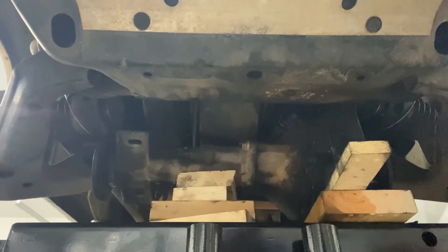The front differential is out — I'll spare you the 15 minutes of wiggling it back and forth. The key tip: as you lower the front differential, tip it forward to clear the rear mounting bracket, which is welded to the frame. Now that we have it out, we can reseal it and possibly put in a new set of bearings depending on how they look. We've got a lot of other projects coming up on this truck including a front suspension rebuild, so please subscribe if you enjoy this content. Thank you.